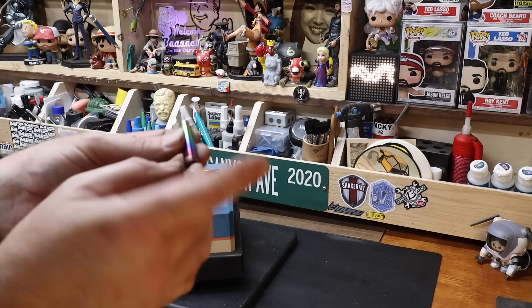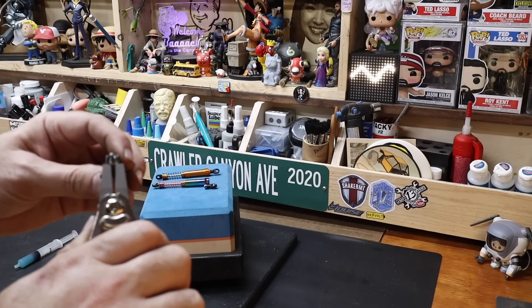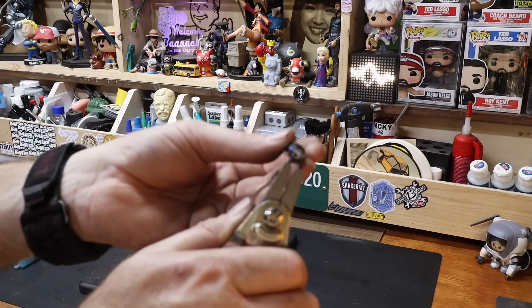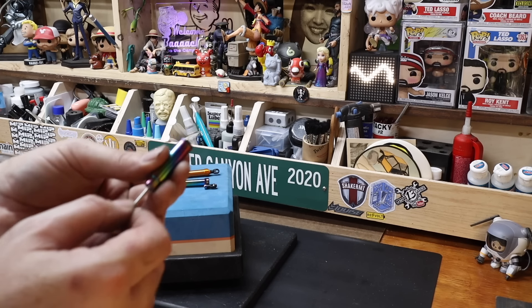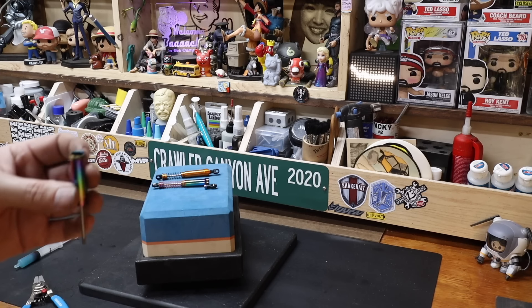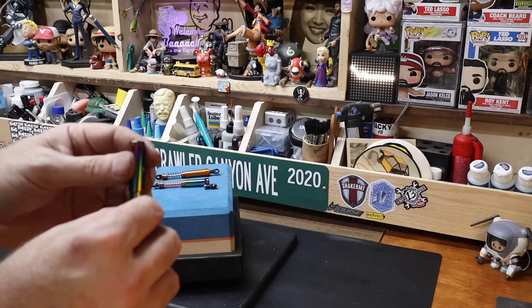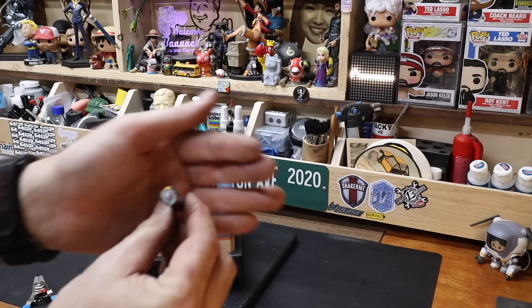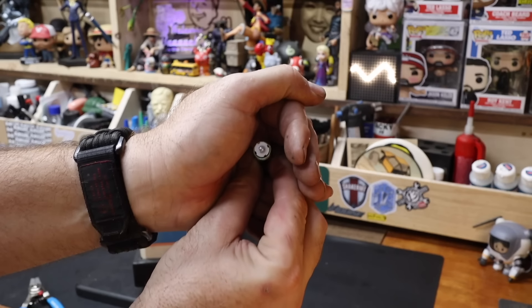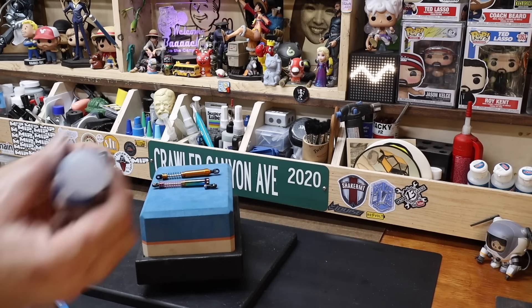What I noticed when assembling these is that your results may vary. What you get as your retainer — whether it be the threaded guy or snap rings — no one can say. You won't know until you get them. There's a definite machining — machining grooves on the insides of the body. I don't know if that's explicitly critical, because these are not drilled pistons, these are slotted pistons. The slots are around the outside edges, and generally when we see slotted, that means we're going to be running heavier weight oil anyway. Those are like two-millimeter slots, so we're going to go 70 weight.